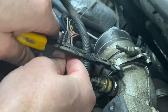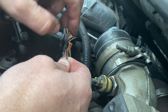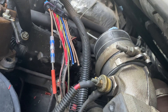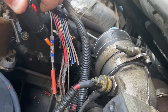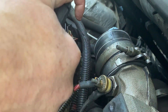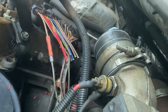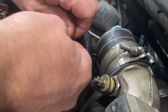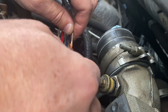Unfortunately, Caboose wasn't able to help me video, so this was a one-man operation. I apologize that you can't see a lot of the work I'm doing, but I think you get the gist. I've cut wires on both sides and then joined them together after I've put the connector on. Using my butane lighter — which Caboose has affectionately dubbed my crack pipe lighter — I heat up the solder and the adjoining parts. The heat shrink wrap over the connector is not meant as a watertight fitting; it's a buffer, because that part is what's going to be going around that bracket that caused the problem. I'm also putting a little bit of flux on the wires before I slide the connector over and heat the solder.